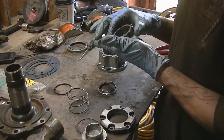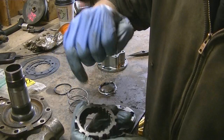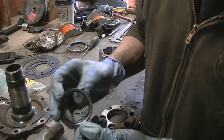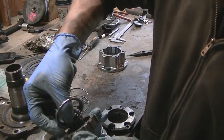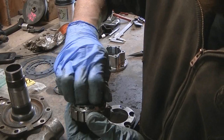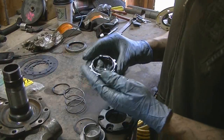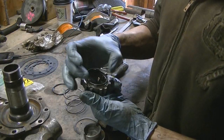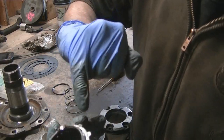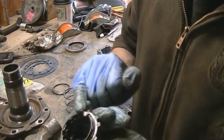Now I've got to rebuild mine. It's got a top and a bottom. The top part has got kind of half the teeth missing and it's got a lip inside it. The bottom part is mostly gear. The pawl has got a spring inside of it, and the spring will thread into that little lip there. You can see it going in like that — it's a little bit tricky but it can be done. I got this guy assembled again. I took the metal ring off from the spring, put the spring in properly, and then assembled the metal piece onto it. There are little lips here and here that the spring rests on, and these two lips here are for that little catch piece on it.